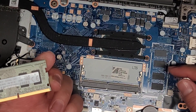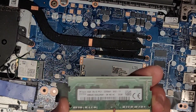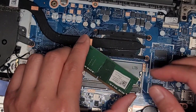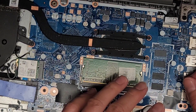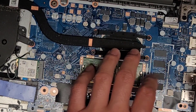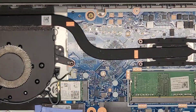Yeah, at that point you might as well buy a new computer — unless you're just wanting to do a fun project. But you can buy 8GB or 16GB pretty cheap, and you can use that if your computer goes super slow. Keep in mind it's not going to run properly in dual-channel mode if you do mismatching sticks.